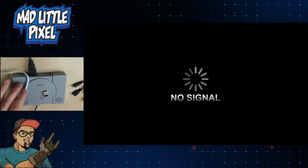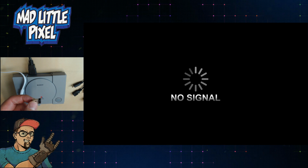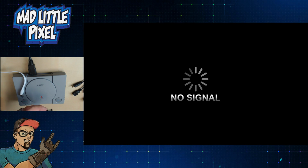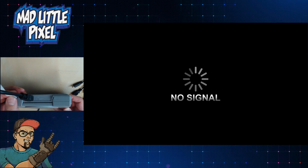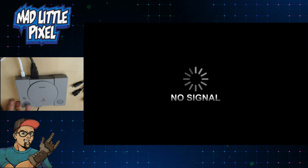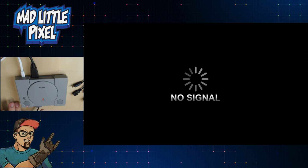Okay, so for the next step, you see I have the power supply removed. I highly recommend doing that. We have our USB drive with the lboot file in the update folder. We're going to plug our USB drive into player 2, plug our power supply back in, and give it a second for that light to turn orange. Come on, there she goes, and then go ahead and hit power. The USB drive may flash once, that's fine. Once nothing is going on, this is orange, hit power.